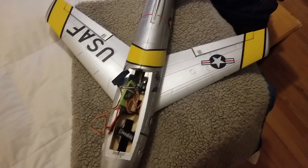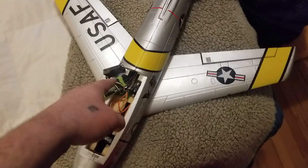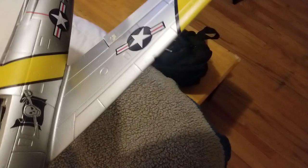We're almost there. I got the batteries charging now. I'll probably go ahead and plug this in just to see where we're at. The gyro will probably need to be switched — there are switches on there that reverse everything and make everything go backwards. So if I pick it up and it's rolling the wrong way or pitching the wrong way, instead of taking the gyro out and repositioning it, I can just click the switches and reverse.